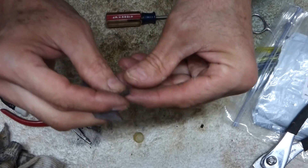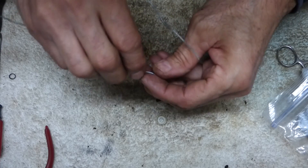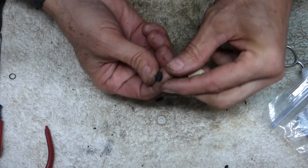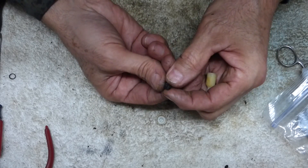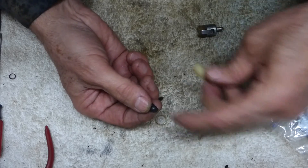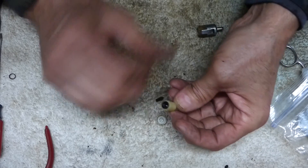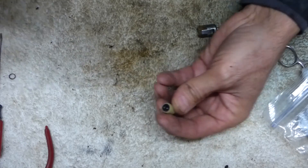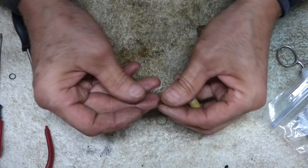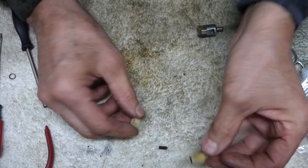That's actually a little filter. You can clean that. Take a little piece of wire or whatever, stick it in here, and you can pull this rubber vent out. You can see it comes to a point there, and if you squeeze it you can open it — otherwise it's shut. That's what keeps you from being able to push air this way, but it'll suck air this way. So you can take that out, clean it, make sure that rubber vent's not all dried out. Push that back in — it just snaps in. Clean this little foam sponge with soapy water. Put that back in, put your cap on, you can go ahead and use it again.